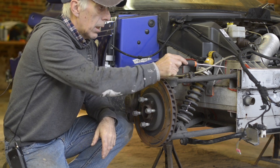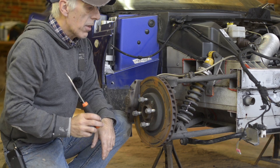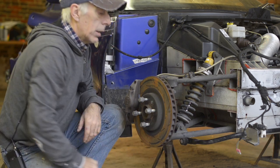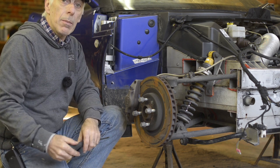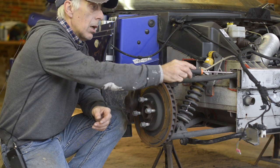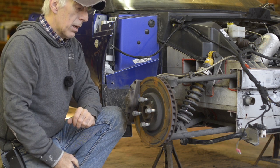This is the front wheel of the Lotus Elise. The bushes we will replace are on the top wishbone — one there and one over there — and then you have two more down here. With the tool we're going to use, they at least claim we can do the replacement without removing the whole wishbone from the car.